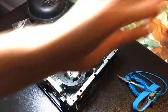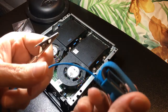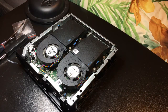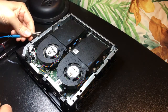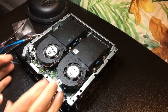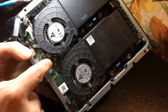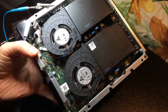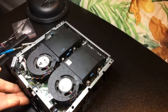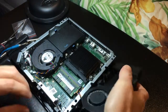Mine's a little dusty inside, so I may have to clean that later, but for now I'm just going to show the hard drive installation. As always, make sure you get a wrist strap with the correct resistor inside so you don't get shocked, protect your equipment, and protect yourself. Hook it to the frame first. Now, you want to remove this CPU fan right here — right in there is where we're going to install the hard drive. See that screw hole? That's where it goes. To get there, pinch and pull off the CPU fan — there is a wire in there, so be careful not to pull too hard.